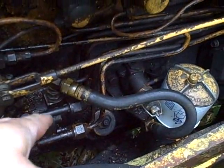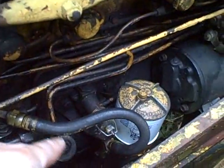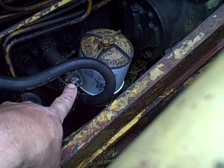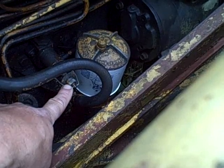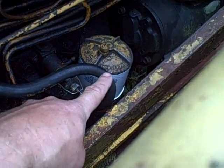So to sum up, basically there's no pump between here and the tank, unless you do like somebody did and they added a 12-volt electric pump on the other side. The hand primer pump is basically just there for if you lose prime — for instance, if you run it out of fuel or if you're changing your filters.